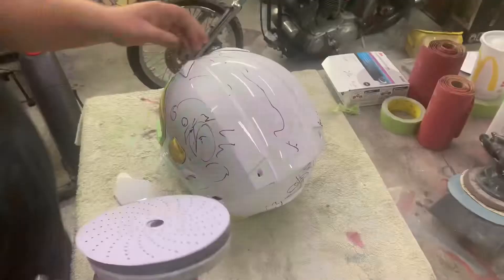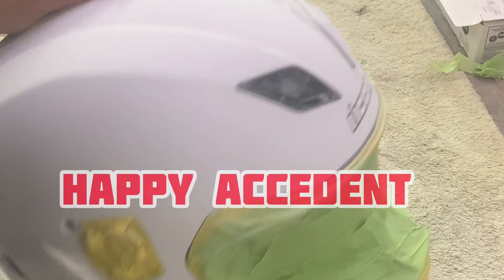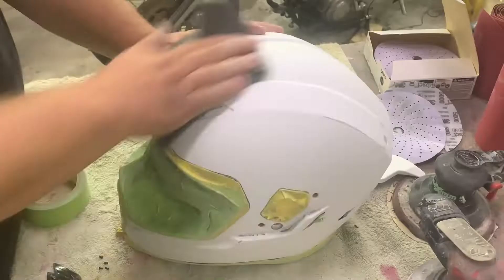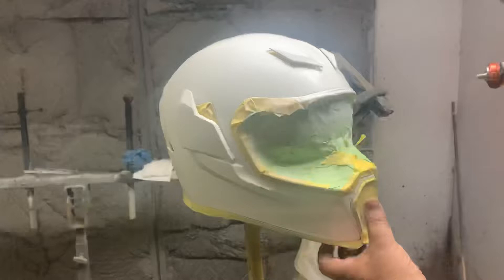Alright people, welcome back — here we go with another full face helmet. I got too close to it with the DA and kind of popped off that little cover, which was good because then I got the seals underneath. Some of the cheaper helmets are just kind of glued on and you don't want to really take them off because they'll never go back on, but this had Phillips screws in it. Smoothed it all over with some gray Scotch-Brite, then did a quick coat of white base just to cover up those logos. Not doing it too heavy because with all the airbrush on top it's going to be buried.